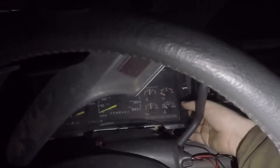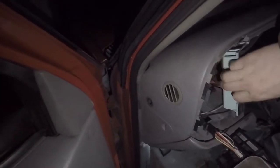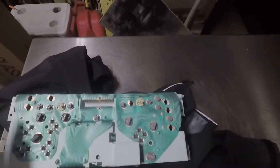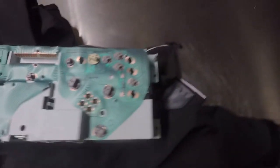Alright, so I got those four bolts out and I'm gonna go ahead and pull this out — like I said you can do it one-handed really. It just pulls out through the little opening. Here is the back of the cluster. It may look a little intimidating — probably not. There are just a couple different bulb sizes; you can technically change out all of these that are offered in your vehicle, you just gotta get the right size. Some obviously are going to be missing — I don't have a diesel, so my glow plug or wait-to-start would not be there.